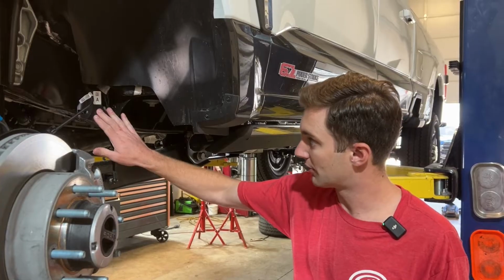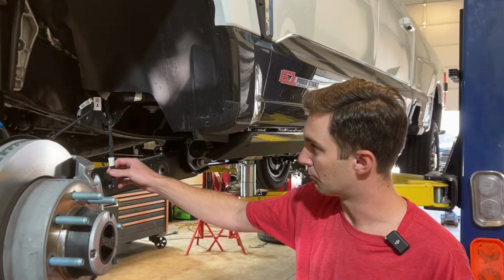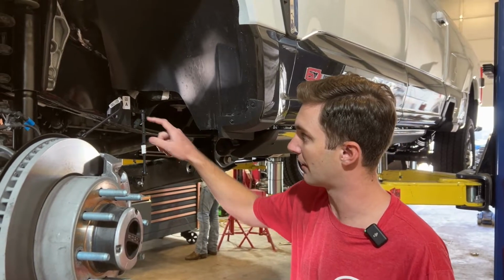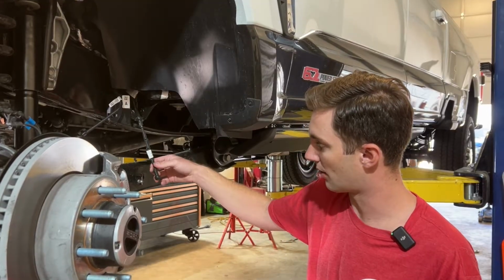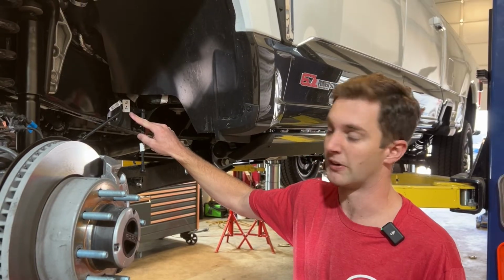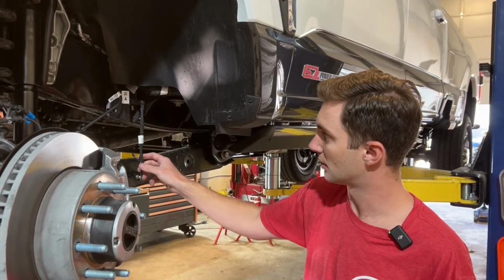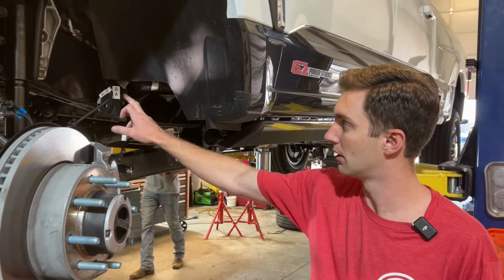Your truck has the level sensors here on the radius arms for the weight scale and the automatic headlights and everything. It's really important to get these removed before you start tearing out any of the shocks or drop the axle. Otherwise, it's just going to break this arm in half. We have new arms, so if you do break it, you can get one from us or from Ford. But just pop this ball off with the panel popper at the bottom, after marking it for your ride height. So two very important steps to do before you tear anything apart. One is to mark right here so you know ride height when we go in with the new adjustable links right here, and step two, get this removed before dropping the axle out of the truck, just to save yourself one of these brackets.